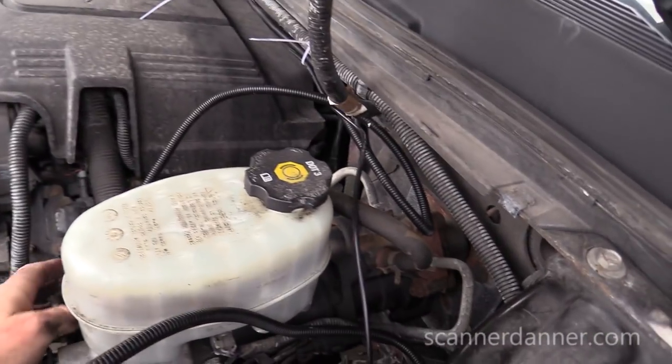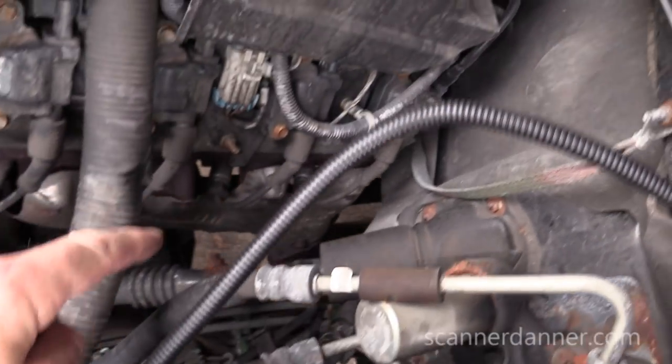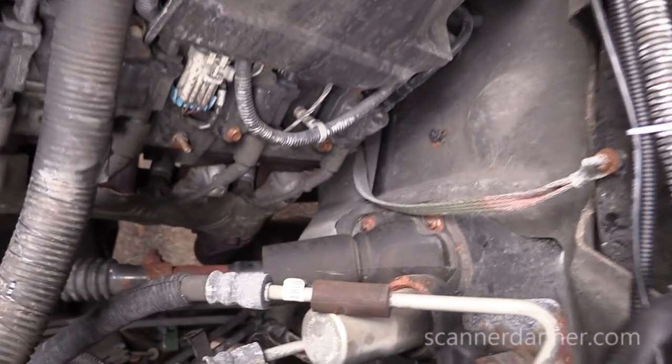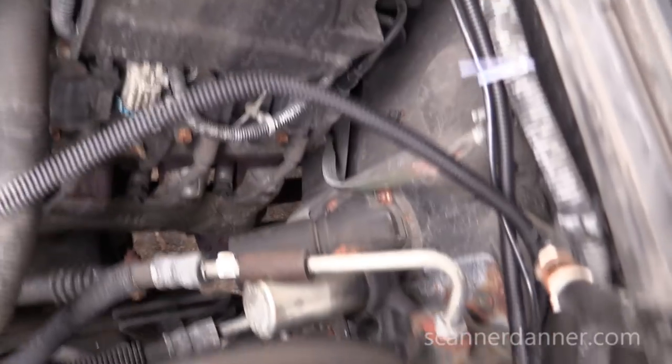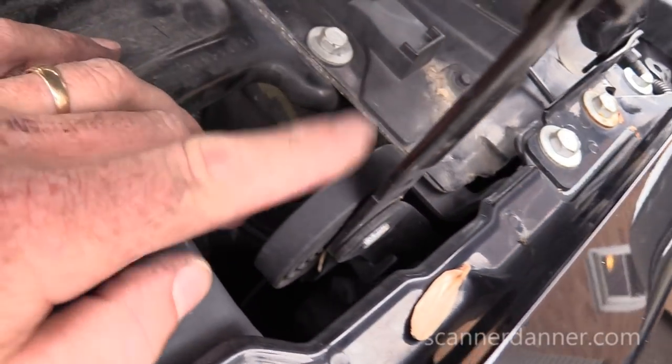So what we want to do, Beau, is keep this away. See this rod that comes down out of the inside? That's called your steering column, okay? And that moves, so we want to keep this harness away from anything that moves. So this area down in here is very safe. We just got to keep it away from the hood hinge because that part moves.